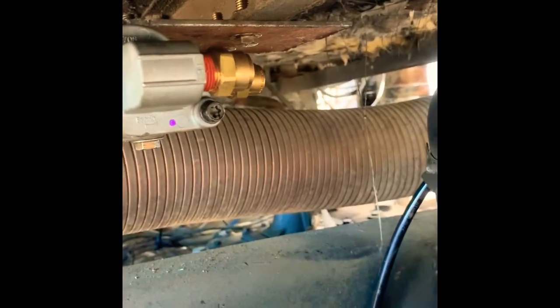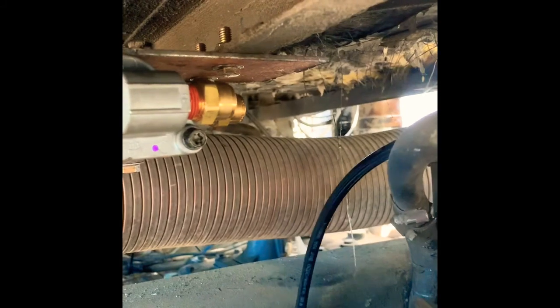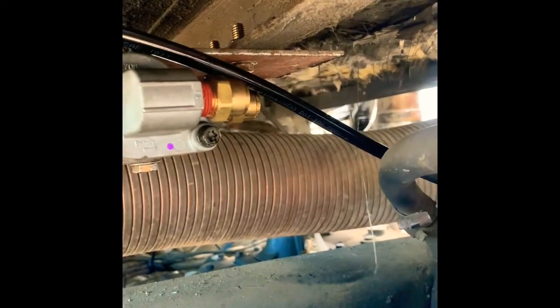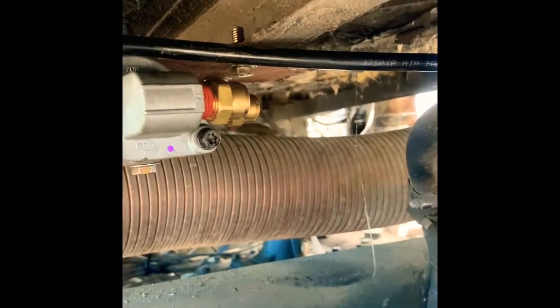And next I'm gonna hook up my 3/8 delivery from my control valve up in the cab for my trailer valve, and then I'm gonna find my secondary and primary airlines. The circuit's figured out here and where they are. Go off the front brakes first. This will be your secondary system.